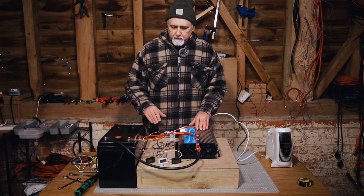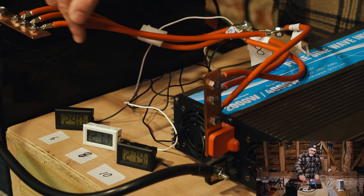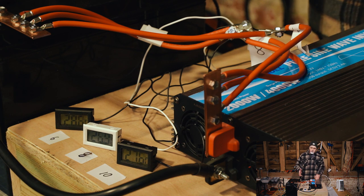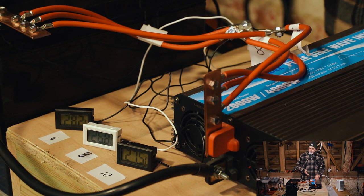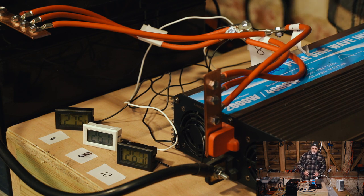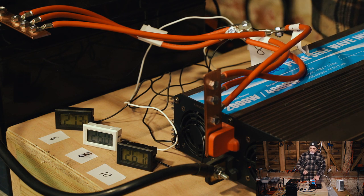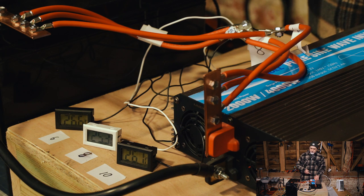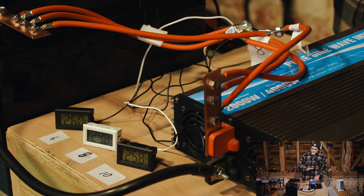We've run this for about 15 minutes now, and as you can see there is very little difference. We started at roughly 3 degrees centigrade and we've gone to around 28 or 29 on all three of them. I have to say this is not what I was expecting. I really thought the 6 Nm would climb well above the 8 and 10. I was expecting 8 and 10 to be quite similar to each other, because 8 is quite a tight feel in these nuts, and they're not meant to go much higher than 10 Nm if they're stainless steel — if they're high tensile, obviously they can. Very interesting that they have very similar heat buildup.